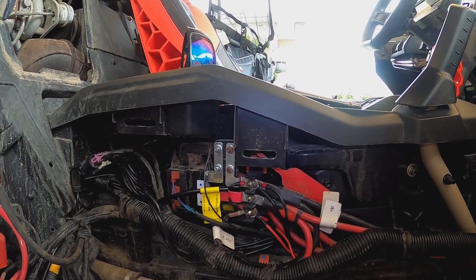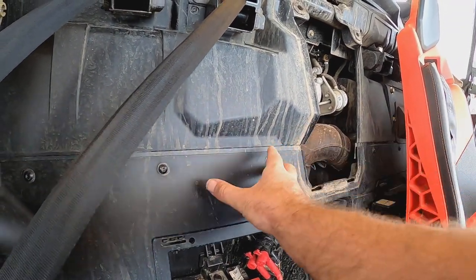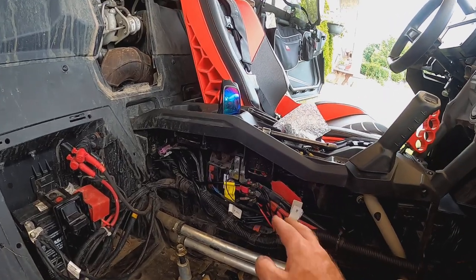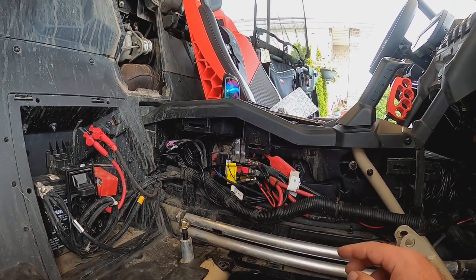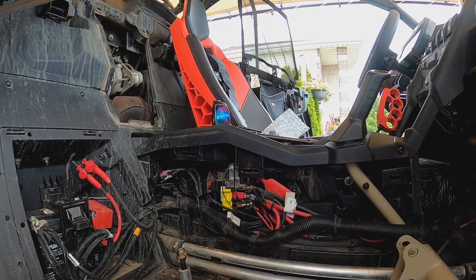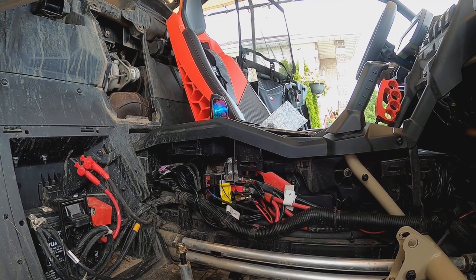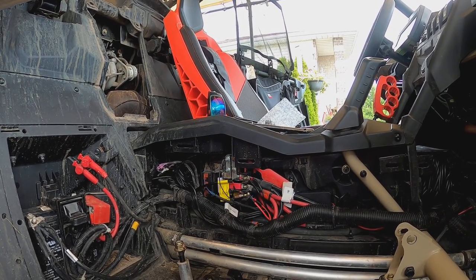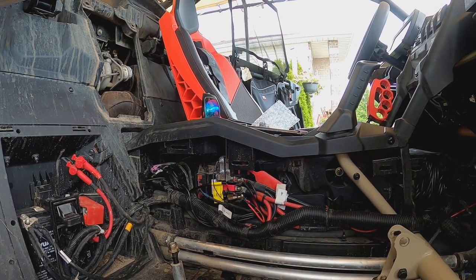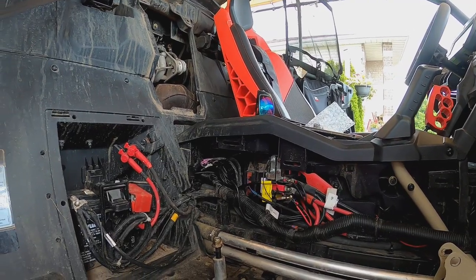We'll be back at this — I'll probably show you guys when I install the block. I'll probably mount it right here above the battery, have all my fuses so I can go behind the seat and check them regularly if needed. I had concerns because my winch runs off this post as well for the accessories, and I was wondering about load. I talked to the guys at Bay Marine and one of the techs told me they actually did upgrade the stator unit and the charging system on the later model X3, so he expects no issues with running it this way for now. I was gonna just run down and spend another 30 bucks on rocker switches, but what's the point — that's a case of beer for the weekend.